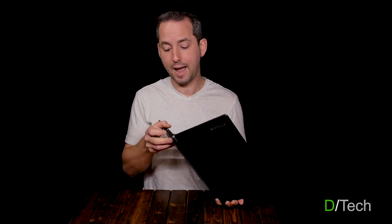You can do 4K out of the HDMI port. People reported no problems doing both 4K UHD (3840) and DCI 4K (4096), both at up to 60Hz out of that port — no problem. Just make sure your other equipment is also compatible and capable.